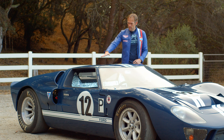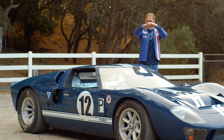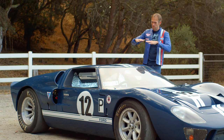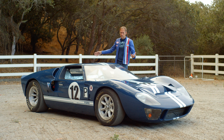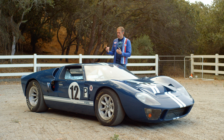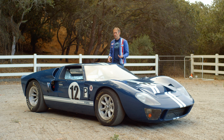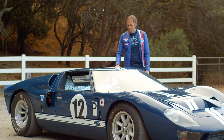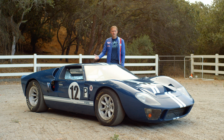There was another problem I fixed: because I'm using Lexan for the rear window, it was causing the rear clip to sag up near the top. Without the Lexan, the fiberglass held its shape, but the weight of the flat Lexan made it sag. I realized if I just put a strip of aluminum bent at a 90-degree angle and shaped it with the right curve, I could bolt it to the screws I'm already using to hold the Lexan in. That holds the shape, and it even puts a slight curve in the Lexan itself which makes it stiffer. I also tightened up the panel gap while I was at it.